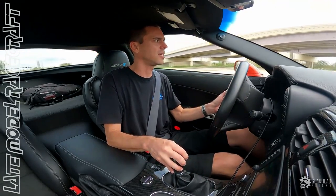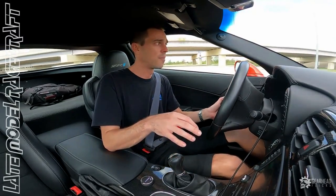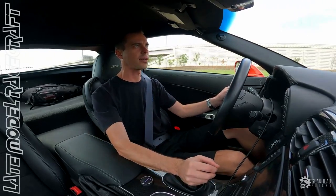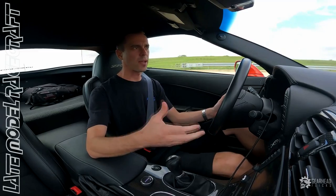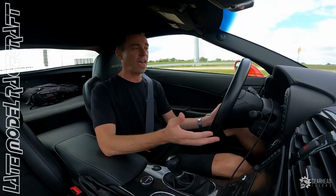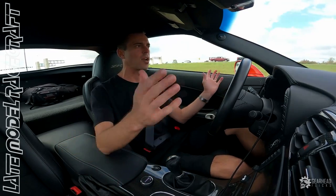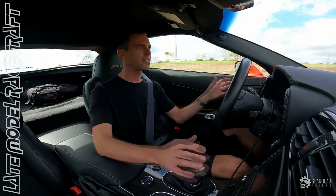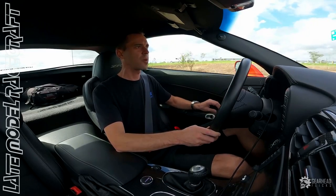This car has our complete heads cam package. These things come with 2300 superchargers from the factory, which we do port, and we make great numbers with those as well. But in this case, I went ahead and put a 2650 supercharger on it, plus the headers and exhaust it came with. Obviously we had to do a complete fuel system to support a thousand rear wheel horsepower - three pumps in the tank. One pump runs just to idle and drive the car; once it sees boost, the other two pumps kick in. For you guys out there with a C6 platform, this ZR1 is a special car.